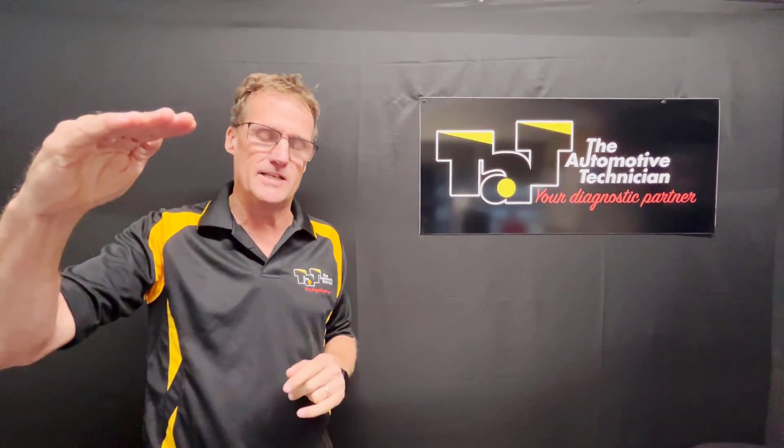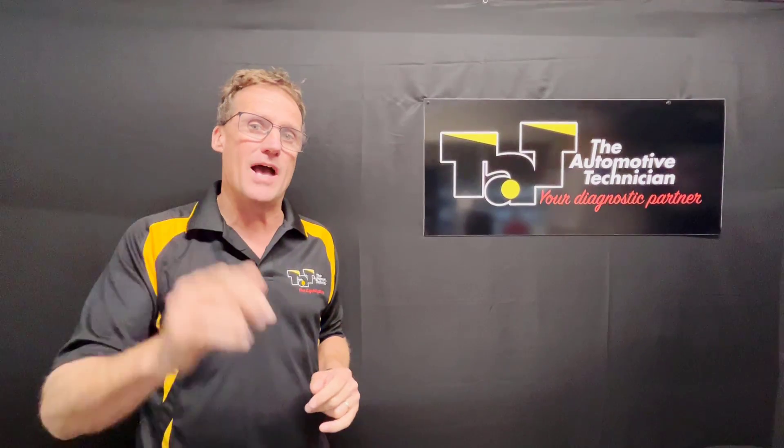A final wrap-up on our Nissan battery replacement for the Nissan Leaf. At the end of the day, we ran out of time and didn't do a final video at the time, but just to give you a wrap-up. We've got the battery pack back in again. We cleared the fault codes and were looking at the live data of the batteries. When we started this particular job, our voltage difference between our best cells, which were running at 4.03 volts, and our bottom one was 2,300 millivolts — so 2.3 volts.